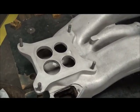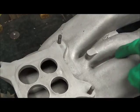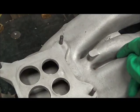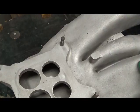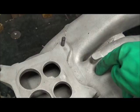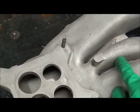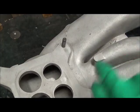One of the tougher sections to paint and to clean are these valleys, these recesses in here. It's just hard to get at them for cleaning, but it's also hard to paint because the paint won't want to spray into the area — it'll bounce back up. So you've got to use some talent. I use light coats in here and do a bunch of them from different angles.